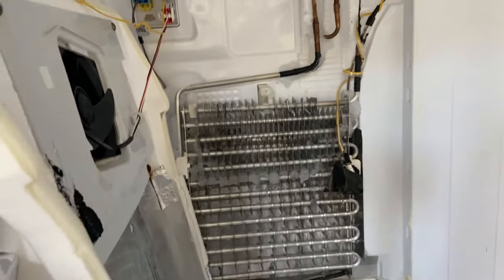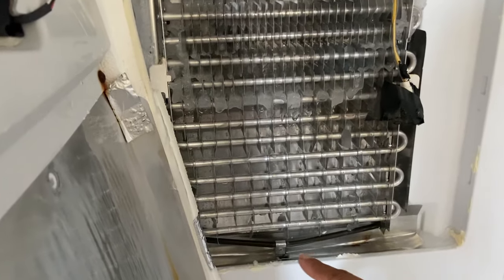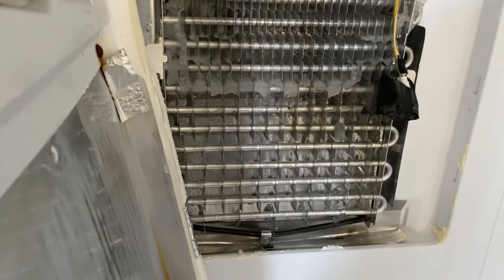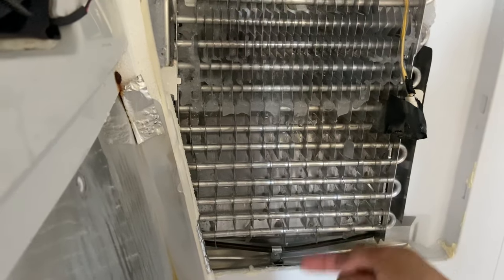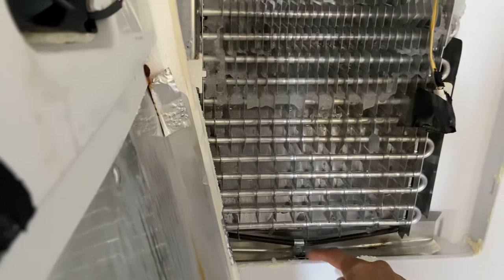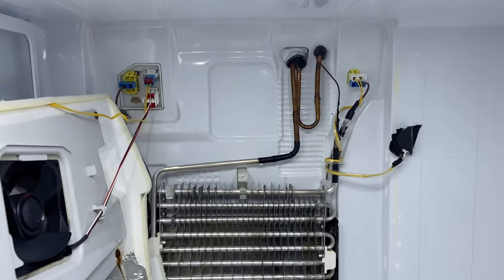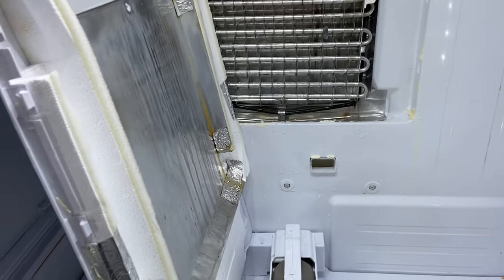These French door refrigerators have a drainage system right here, so all the melting ice is going down the drain. If you see a buildup that isn't draining, grab a thick wire — like from a wire hanger — and stab it down into the drain, because there's probably ice blocking it. Break that ice so the water can drain away. Once everything is melted, make sure it's completely dry before you reinstall and screw the panel back on.